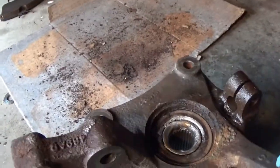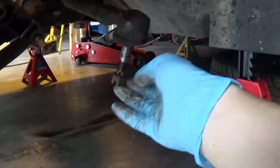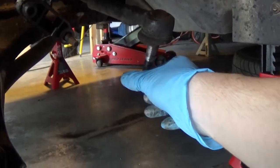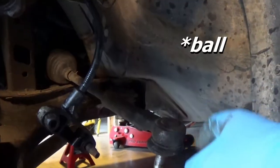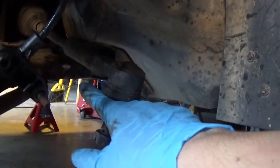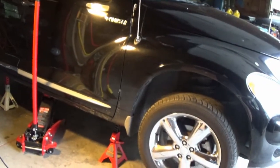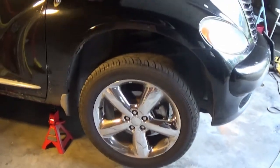I'm pretty sure this is the side with the bad bearing. Something to note about the tie rod end — the way I pulled it off by putting the nut on the end and hitting it is a very bad idea. The threads are okay and the bolts will thread, but I messed them up a little bit. Also it's not good for the knuckle inside to be banging on the bolt. The best way is to use a pickle fork. Now that that side is finished, I'm going to do this side off camera really quick and show you the bearings when I'm all finished.